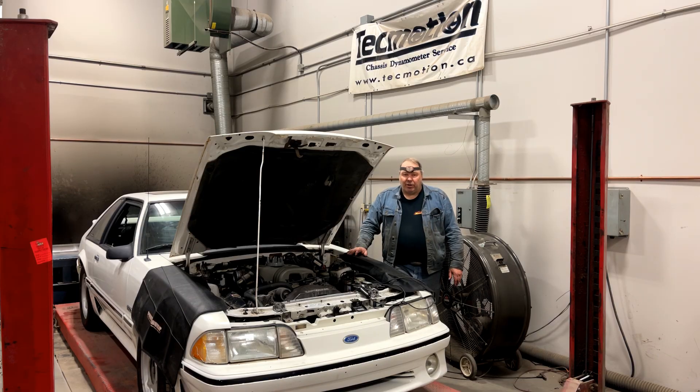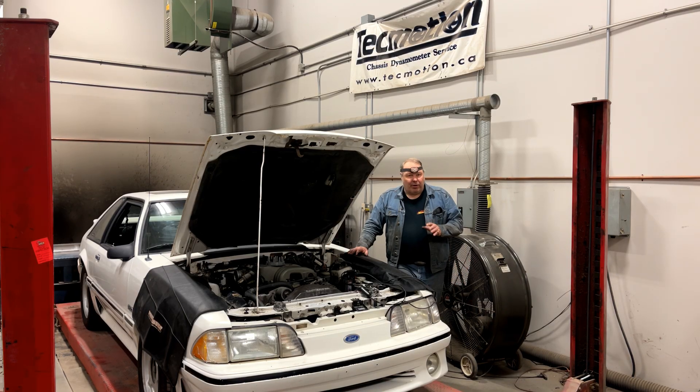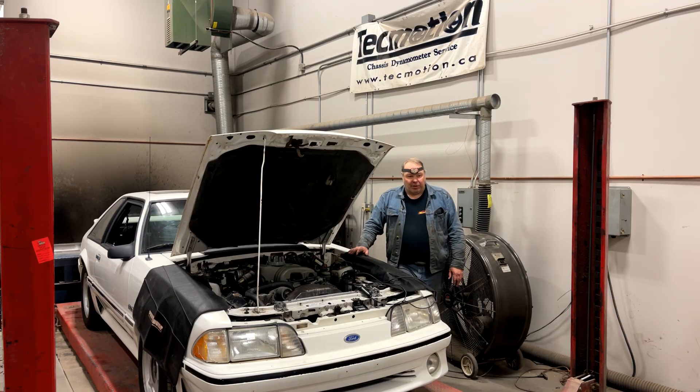The engine seems pretty good. I didn't do a leak down on every cylinder because honestly it looks like it's pretty good, and that's probably not a big surprise given the okay dyno test we started with. So I'm going to go ahead and gap these new spark plugs at 45 — not 55 like the ones that came out — put them in, put a new set of wires on, and then we'll be ready to start doing some dyno work on the car.